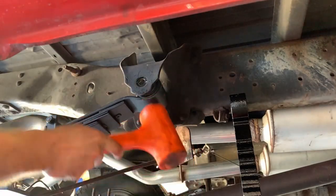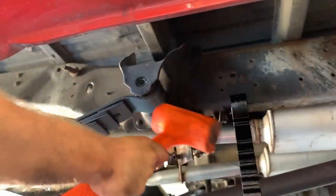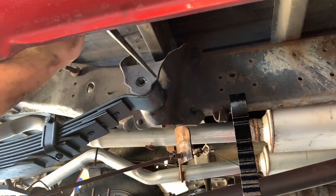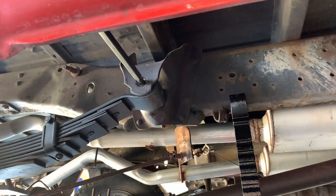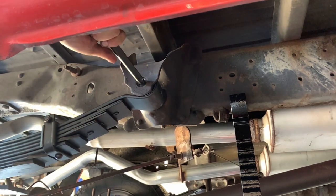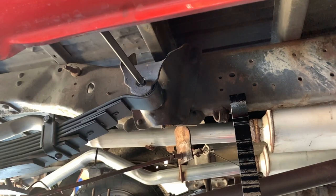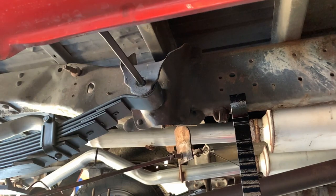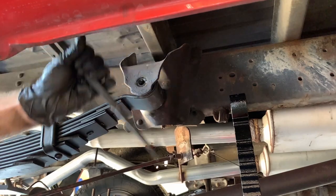Patience will be a virtue for all of your mounting points. You'll need to use all of your implements to negotiate the spring into place on each mounting point. A very handy tool is the tapered end of your crowbar, which can be placed into the holes and then gently hammered into place in order to better align each hole. This will do a lot to help get you to a point where you can actually start to put any of the bolts in on either side. But you want to be careful that the tip of the tapered end does not dig into the metal on the inside of the bushing, and instead is aligned all the way through the hole so that it better aligns both the spring and the mounting point itself.